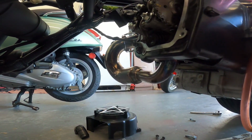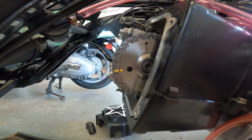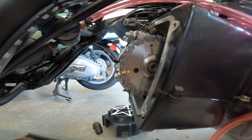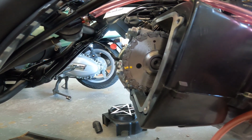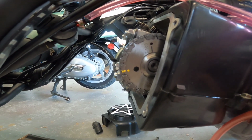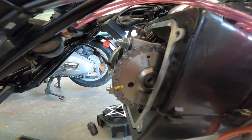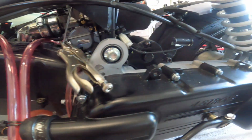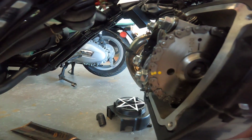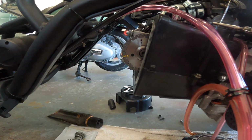Now, with all the care I took to get this exactly right, and I put that dot on there, look at that. See the mistake? That's the mistake that a lot of people in shops make. And that's why that bike will never run good, because that cam is not lined up. I moved that chain when it got slack. I actually moved it a few teeth down here on the crankshaft. So my yellow lines mean nothing. I have to have this lined up also.